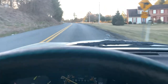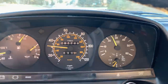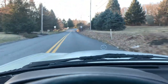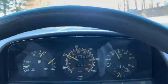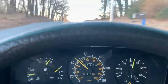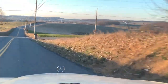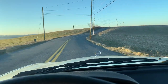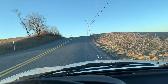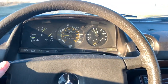She'll pull this hill easy. People wonder — is this diesel going to be terrible? Older naturally aspirated ones can be rough, but this car you could drive. She'll be turning some RPM on the hill, but she'll do it. She does smoke when you hit high RPM, so the two next big items on my list are adjusting the valves and rebuilding or checking the injectors. But anyway — see you in the next video.